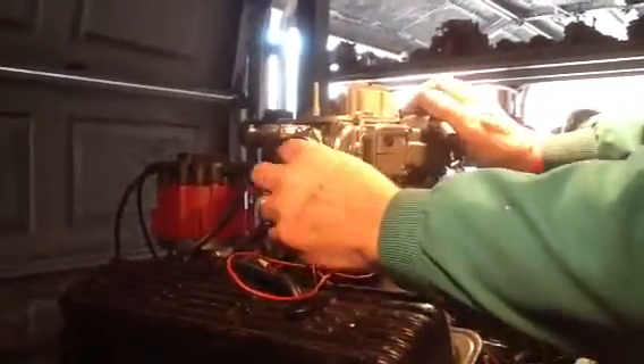Then the heat — when you turn your key on — it will heat that element up and pop that choke right up. Nothing to do with carburetor heat; it works strictly off that coil inside there. This one also has a Ford kickdown on it.